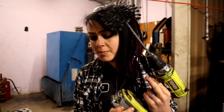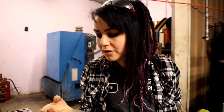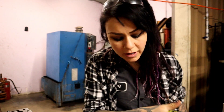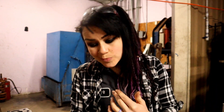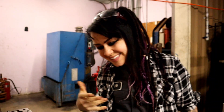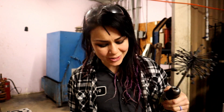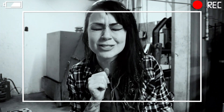After I clean up the top of the pistons, I'm going to go through, put the cardboard on top of the pistons, and rehone — deglaze — my cylinders. They have gotten to a point where they're a little bit glazed, even though the engine hasn't run for that long. What I'm going to be doing is basically just taking the glaze off. You don't want glazed cylinders because there's a chance that the rings will never reseat again. I was burning some oil but I don't think I have a problem with oil cooking on the rings. The engine ran fine before — it's had a problem with the cam. So just calm down and do what you're supposed to do.